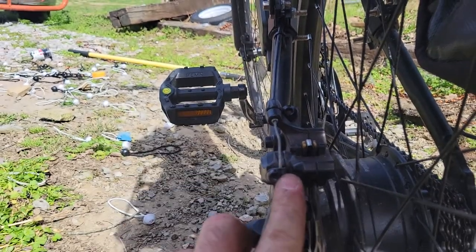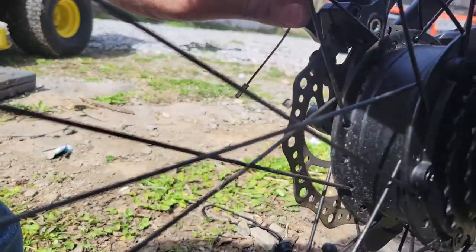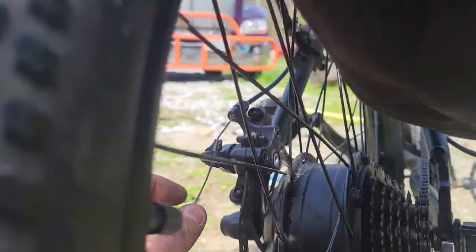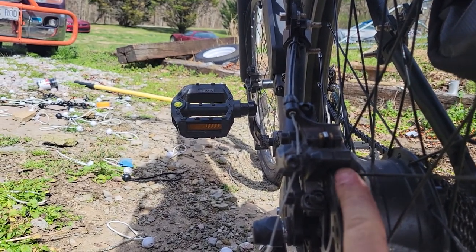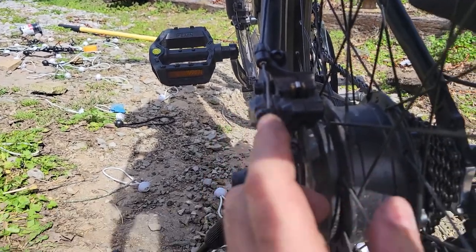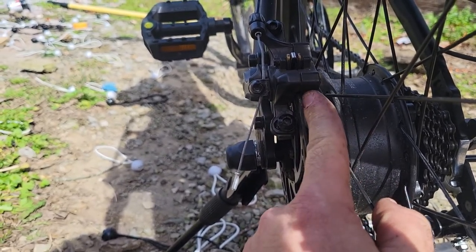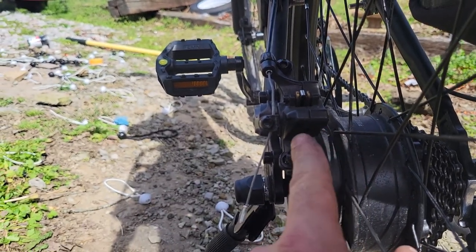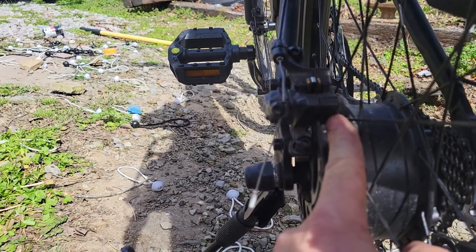Loosen this one, this one, and this one — this will drop down, it won't come off the cable. With the bicycle upside down, give this one a couple of turns until the inner brake shoe touches that disc, then back it off to where it's just barely not touching. If you put a lot of miles on your bike like I do, you're going to have to adjust that rear pad out. It's a heavy bike — 45 pounds — so the brake shoes are going to wear more than standard brake shoes.